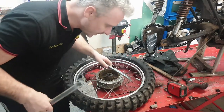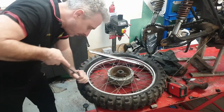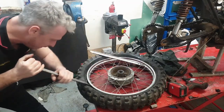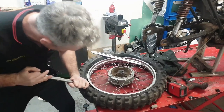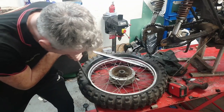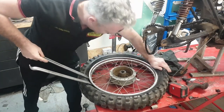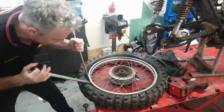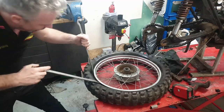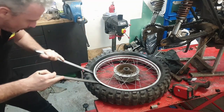Don't use fairy liquid - fairy liquid contains salt. When you've got a tube in, you should always start and end at the valve. We don't need to press it off the bead because this tyre looks so old and it's a tube type anyway. What you need to do is press the tyre down into the channel of the rim - it just gives you more free play at the edge you're trying to take off. The horrible thing about fitting tube tyres is nipping the tube - it's so easy to do. Use plenty of soap, makes it a tad easier.